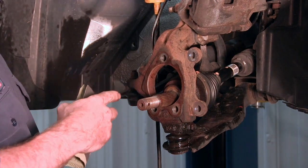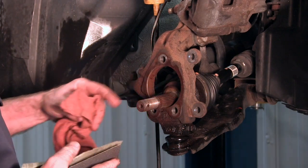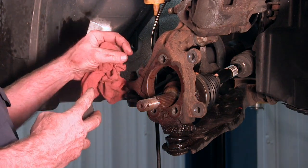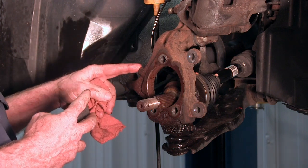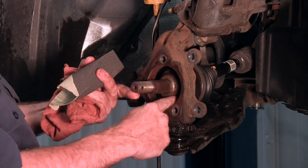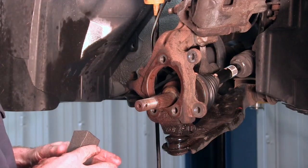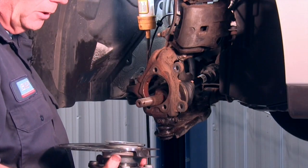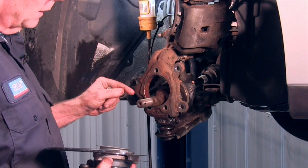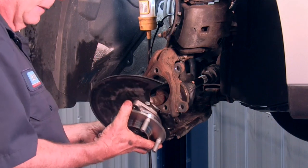Before you install the new hub, it's a good idea to clean out the steering knuckle with a little sandpaper all the way around. Also, where the ABS wheel speed sensor is, it's not bad to use a little crocus cloth and clean that out, because a lot of times rust builds up in there. Nissan also recommends a little moly coat on the back side of the CV shaft to help ease installation or removal at a later time. We've got the new one ready to go in — we cleaned up the knuckle mounting surface, put a little moly coat in, and we're ready to install and get the three bolts back in place.